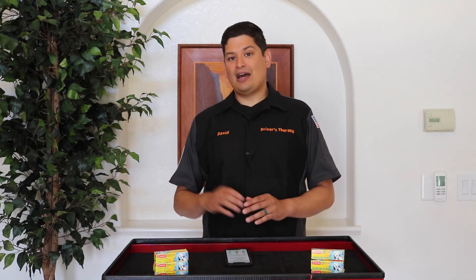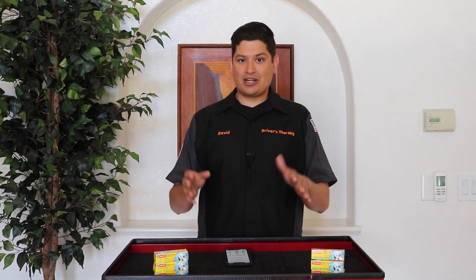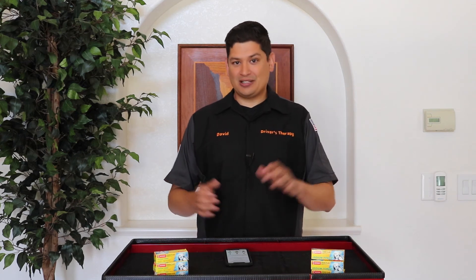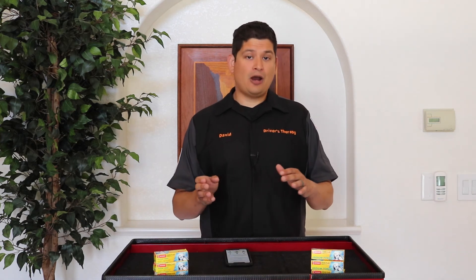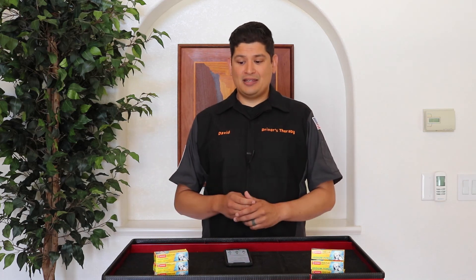Long story short, I went back some other day and I was going full throttle, and the misfire was gone. These actually fixed my issue, and I was pretty happy about that, because usually I get these gremlins and I'm chasing them trying to figure them out. The colder plug fixed my issue for a BPU car, and it kind of made sense because I had added a decent amount of power from OEM stock, and this ended up working out.